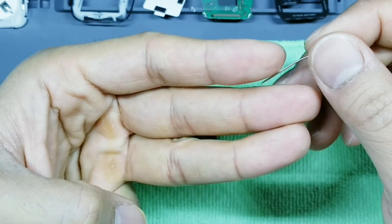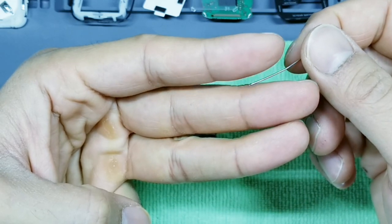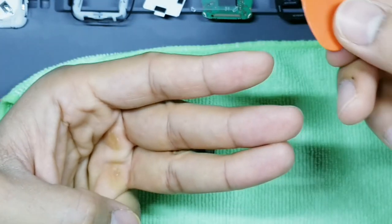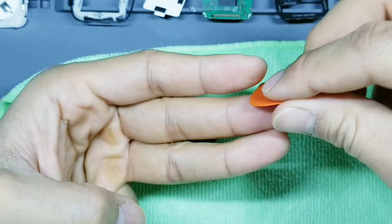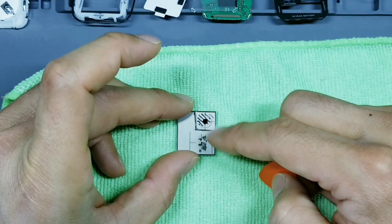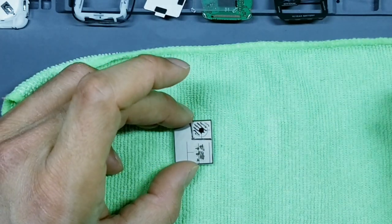And then once you have that pin in there, you'll move the pin to the side to loosen up the glue between the two layers, and now this will be pre-loosened. You'll set your pin to the side. You'll grab a guitar pick, which I forgot to mention if you have one, or something soft, even a credit card might work. And then you'll wedge this credit card in and start working away at the top layer, again, just for that portion that I've put in the black shade of the Sharpie there. Okay, so let's take our pin first.